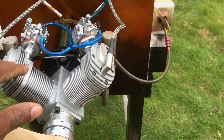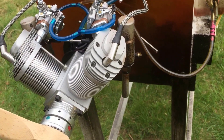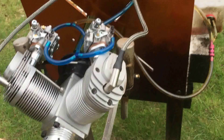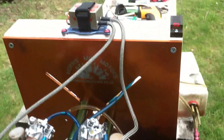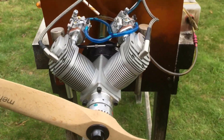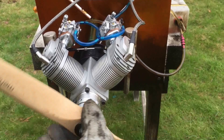It's a Laser 360V, been converted fully to gas, dual magnets and a dual output sensor — one single twin unit, RCXL. I do carry the CH ignition brand as well. Two WT carbs, and I'm going to give it a start and see how it goes.